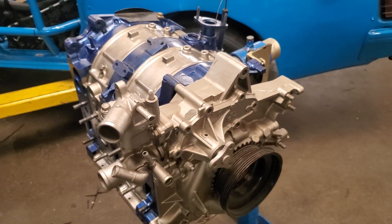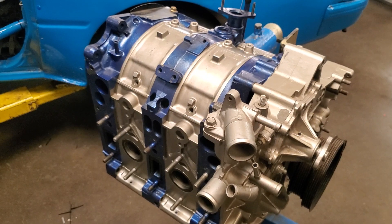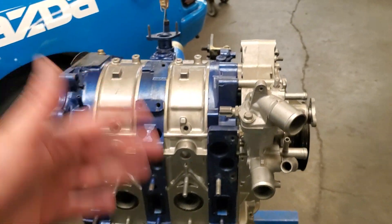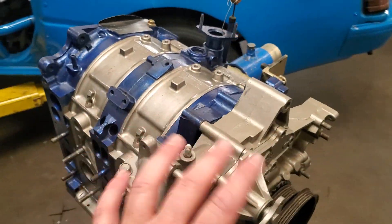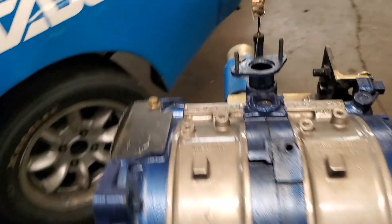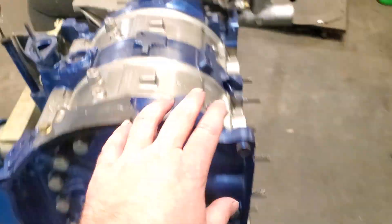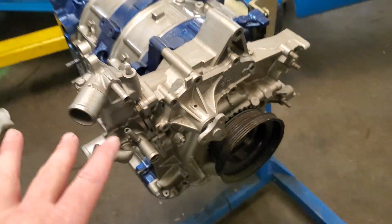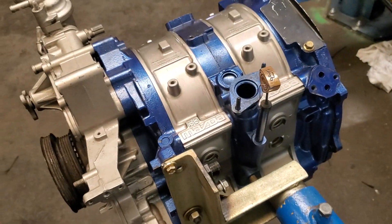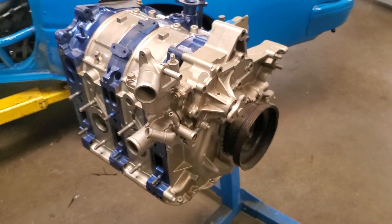You're also going to need a standalone fuel management system and upgraded fuel pumps — if you're adding more airflow, you're going to use more fuel. In our case we got rid of all the OEM intake manifolding and went to a more race-style aluminum setup, doing away with a lot of the valving as well. When turbocharging, much of that is less necessary. As we started to up the boost, we went to a fully studded block, shimmed the oil system to increase oil pressure, side-cut the rotors, and balanced the assembly — all done via Mazda Trix when I was in the engine department there.